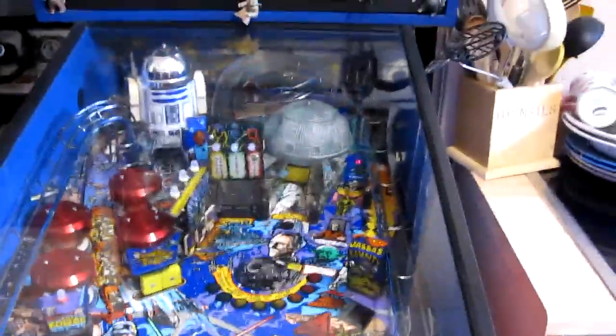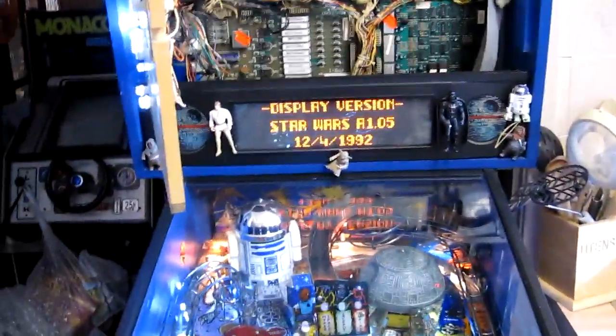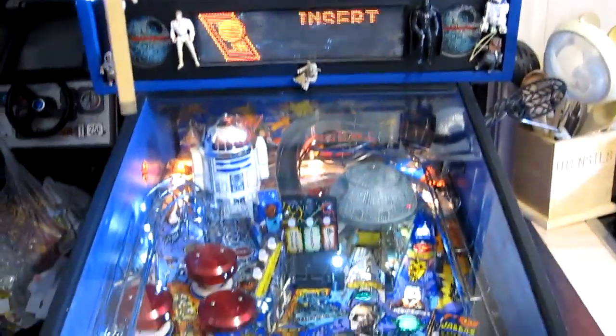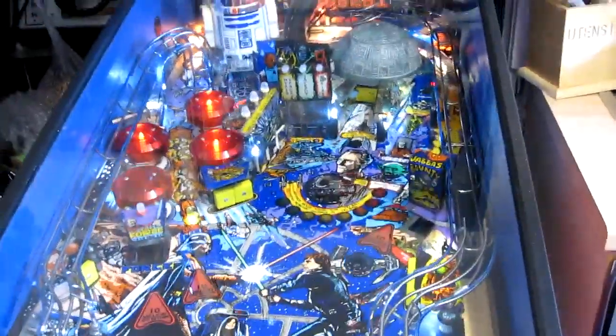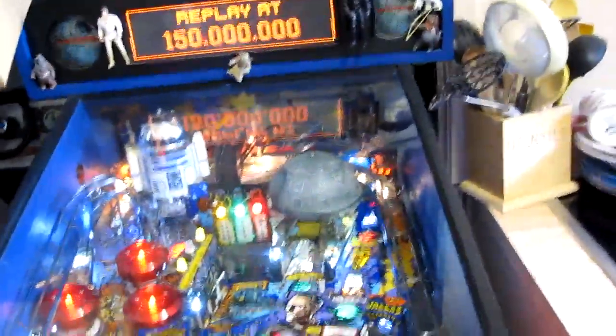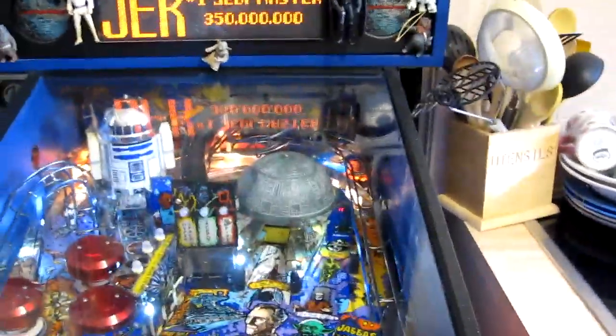'May the force be with you.' I'll open the door. No batteries in, so we need to initialise it. There we go — the game is initialised and ready to go. That's a good sign. The best thing now is to step through the self-test modes and make sure that everything's working as expected, so let's put it into self-test.